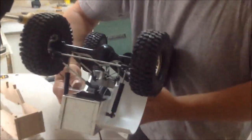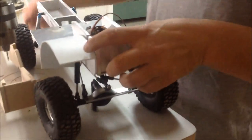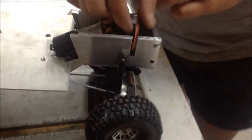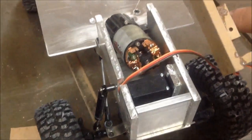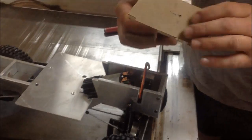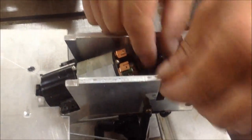Now we're going to figure out where we're going to put our servo. If you take a look underneath here, our servo is mounted a little bit further back — and that's where I have put the notch. This is where I took off the inner fender well — I just removed it — and this is where the servo is going to be. On the inside here, this servo is a Savox and it fits almost perfectly. I just put in a scrap piece of aluminum and screwed it from the sides. Don't glue this piece because you'll need to remove it to get your servo out. Just put a scrap piece, and underneath what I did is I just pre-drilled a hole — as you can see on my mock-up — where the servo is going to be, and that's where you fasten your servo.